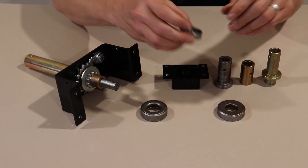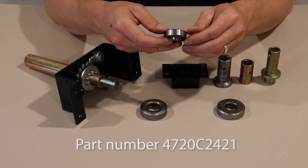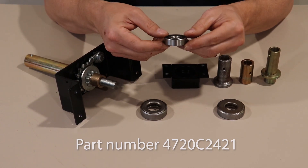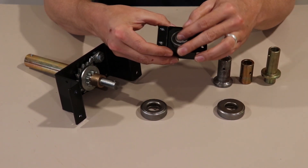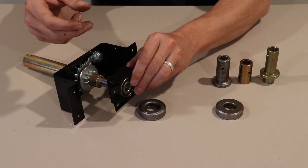Next, the 6311 system. These are found on later direct drive, center mounted crank assemblies. This thrust bearing has no front or back — both faces are open, and you can always find this installed in the bearing spacer cup on your crank assembly.